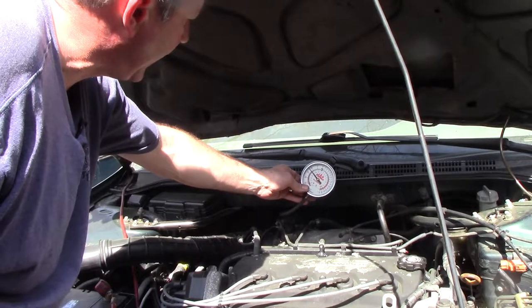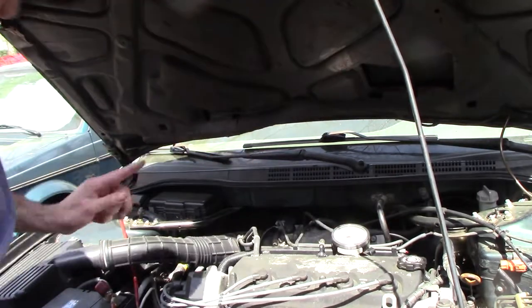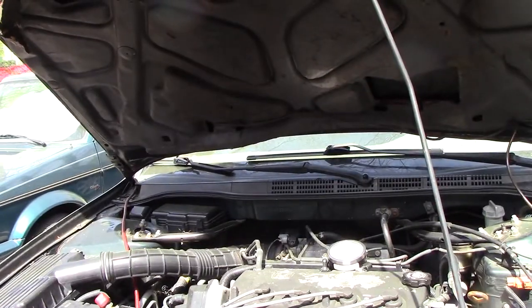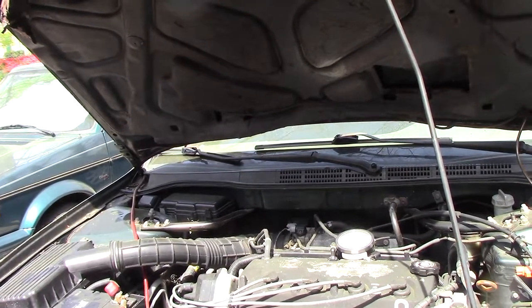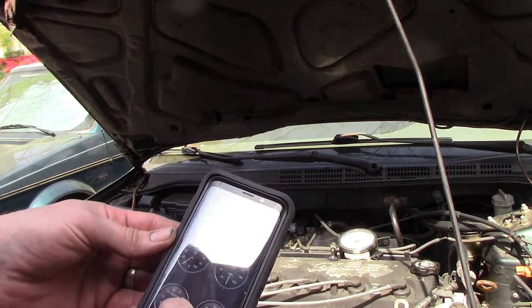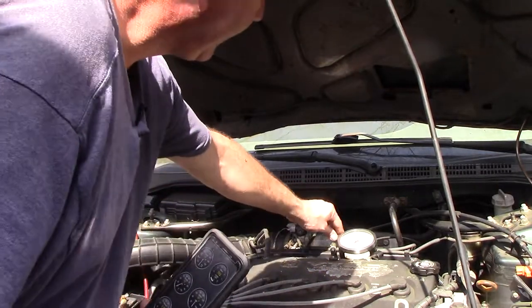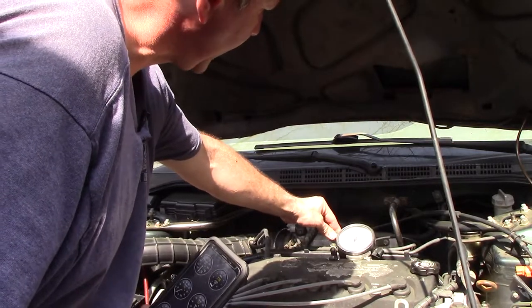Misfire for some reason, but now we have vacuum. So what I may do is clean these spark plugs because they are black as heck. So I hooked the belts back up, disconnected the battery, thinking maybe it would try to relearn itself. No fault codes. Odd, I'm not reading any vacuum going to the ECU, but I'm reading it on the vacuum gauge.